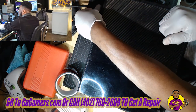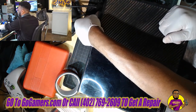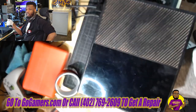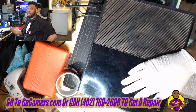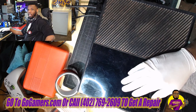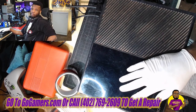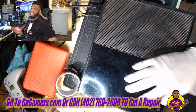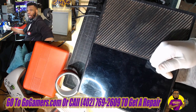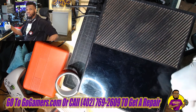With these fat model consoles they don't have a retimer like how the Xbox One S and the Xbox One X models have — it goes straight to the south bridge. So typically if it's not the HDMI port, I rarely see the EMI filters go out over the top of that HDMI port. More than likely it's either going to be a hard drive or an actual south bridge problem.